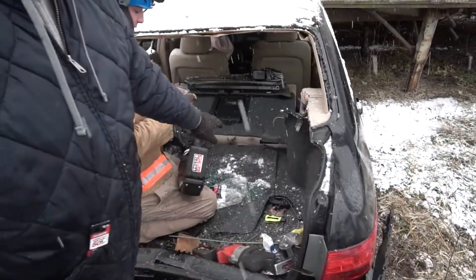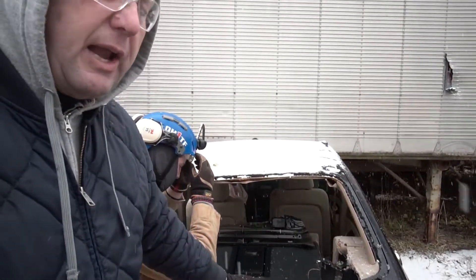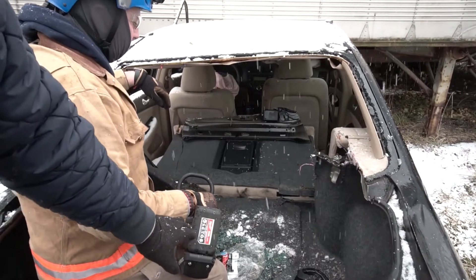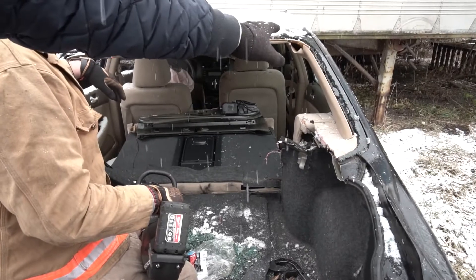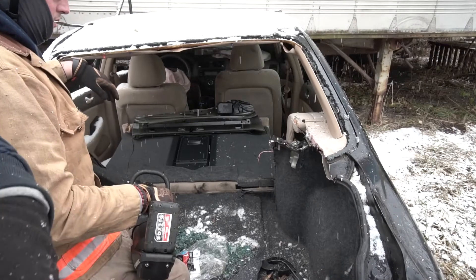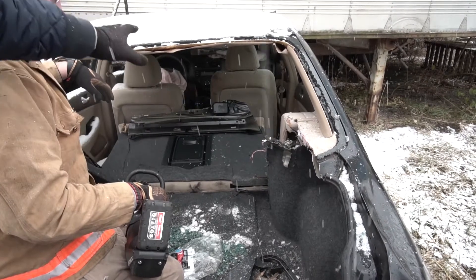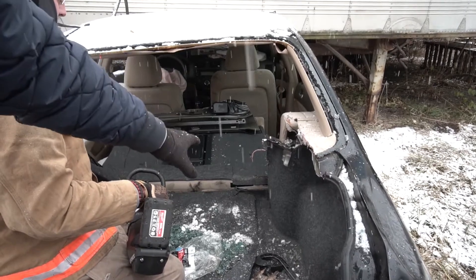The takeaway here is that the back seat and the construction of the rear deck and rear seat components vary widely. You just have to get in there and find out how it's constructed, where it's pinned, and then attack those points. Unlike a vehicle where you can be very procedural in door removal — because doors are highly regulated — those regulations don't necessarily exist here, so we just have to cut away the carpet, examine the connection points, and attack them with the most appropriate tool.